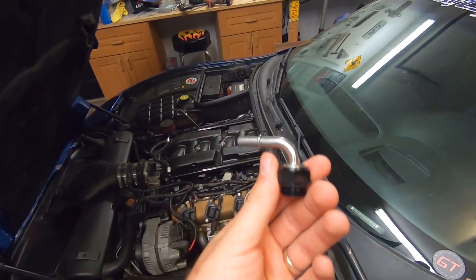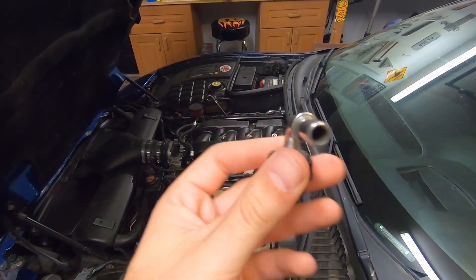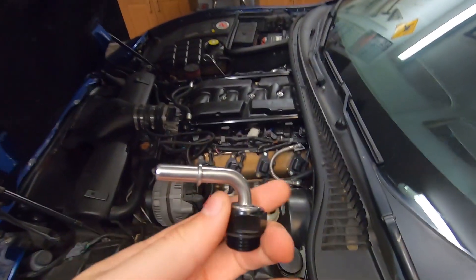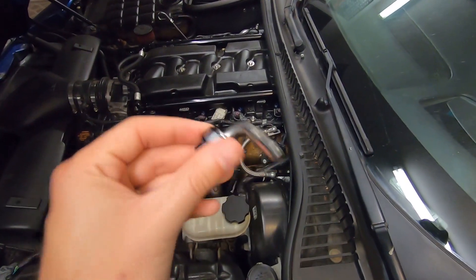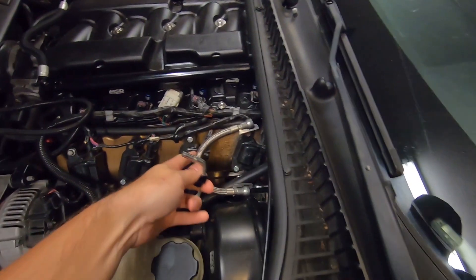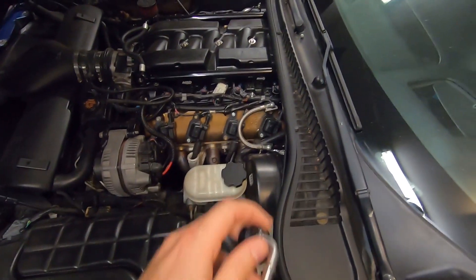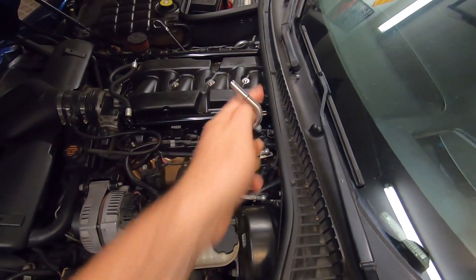This feels like a great piece — it's expensive, about 25 bucks, but you can't really put a price on peace of mind with fueling. This is gonna make me feel at ease with no leaks ever, because there's no room for error and no soft line except for the OEM stuff. So I'm gonna take the fuel rail off, get to the fitting in the back, and then slap it all back on.